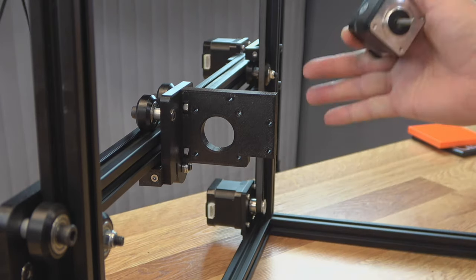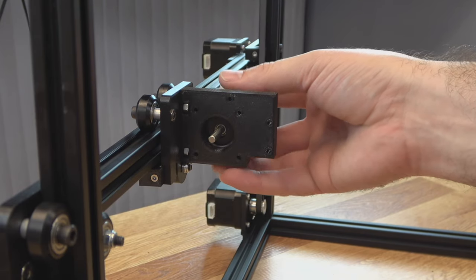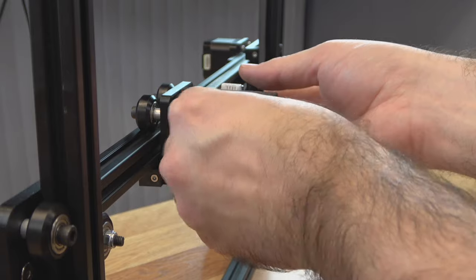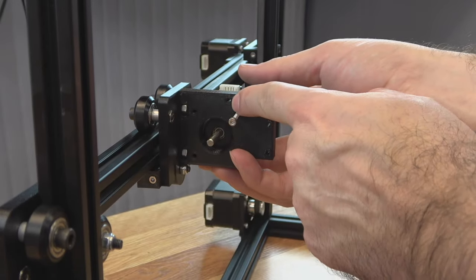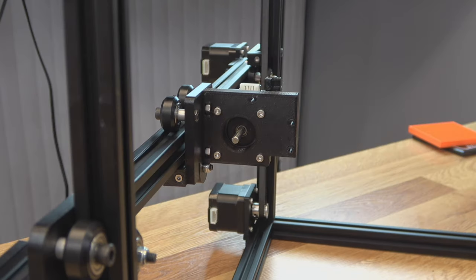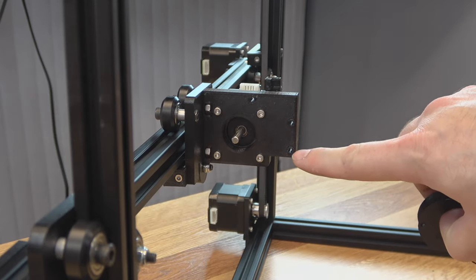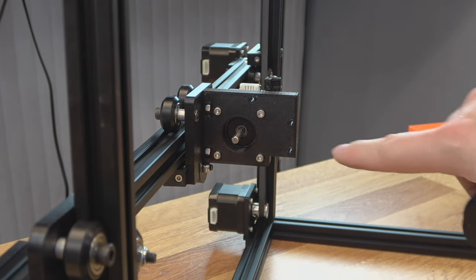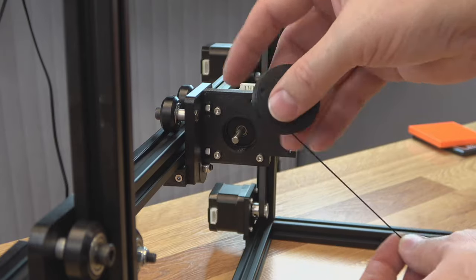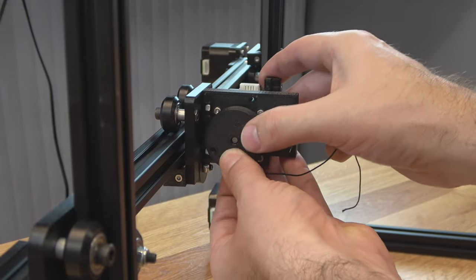And then back to the candy machine. Remember, this is the right-hand side of the machine — you can see the Y motor. The Z motor is going to come in from behind right here, and then you can fasten it down with those M3 by 12s. This is a little thicker mount, that's why I have the extra screw. This hole right here I just put in there for something to wire-tie some wires down to. Once your motor's on, go ahead and put your string wheel on there. The string is going to run down this side where the end stop is. There'll be a cover here with a piece of PTFE that it runs through. It does have a key spot that goes on the motor shaft, and you want that string to run this way. You can always rewrap it if you need to later. It should press on nice and snug.